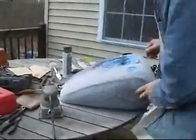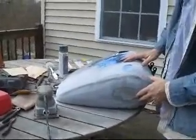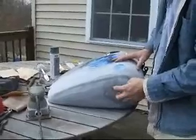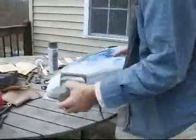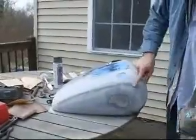Okay, what we're doing is I've taken this dent down to metal because I'm still thinking it through. I may be able to somehow get it out. Otherwise, when we put filler on, we need to have it down to metal. Can't put filler really over paint per se. So I'm taking it down to metal. I've changed the paper already one time, and it's going through.